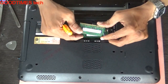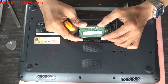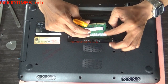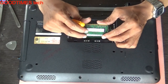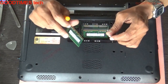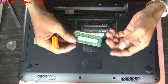This laptop has 2 GB times 2 RAMs, that is a total of 4 GB. If you want, you can go for one more 4 GB — 4 plus 2 will be 6 GB — or else you can remove both 2 GB RAMs and go for 4 GB times 2. Cross-check on any search engine what amount of RAM your processor supports, then proceed with upgrading.